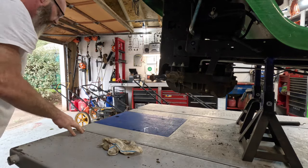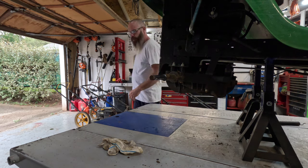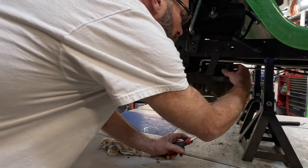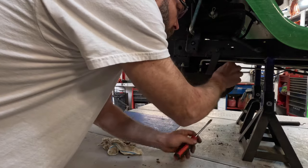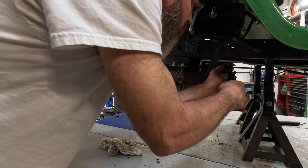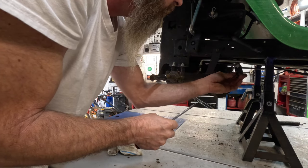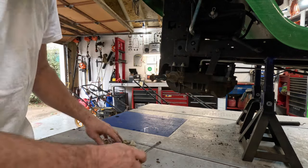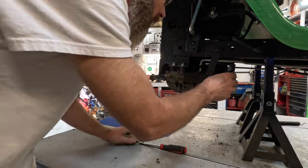I just put my screwdriver up, now I need it back. Go ahead and unhook this sensor safety switch. Come out of there. Well, that just clips right in there like that. That's your neutral, I believe that's your neutral safety switch right there. See, this thing is stuck in reverse, so it's not going to let you crank it. You'd have to cut grass in reverse all day long. That'd make your neck sore.